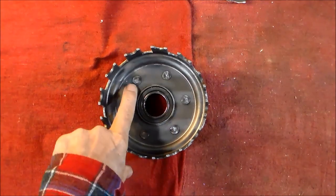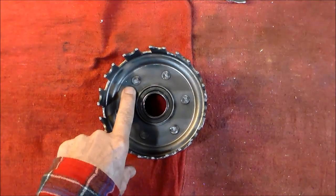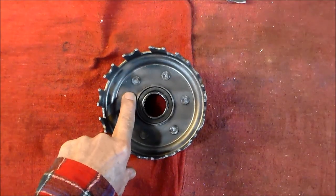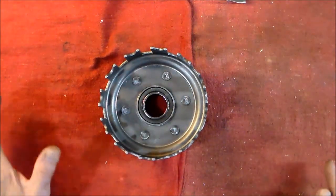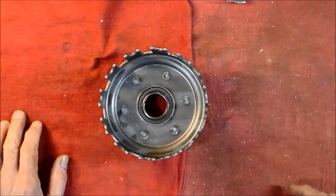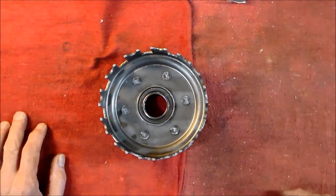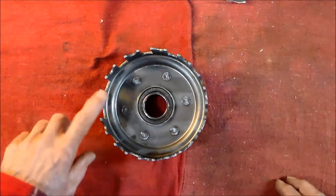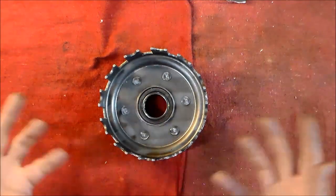The key is finding the center of the rivet, either by eye or by guide. Drill a pilot hole, go a little bit bigger — 15/64ths is what I use — then use an easy out to snap the heads off. You'll know on the first one if you drill deep enough. If you go off center a little bit, I've done it where I came through one of the walls of the rivet and it doesn't seem to hurt anything. So: find the center, center punch them, drill it out, bust it off with the easy out, tap them out — clutch comes apart.